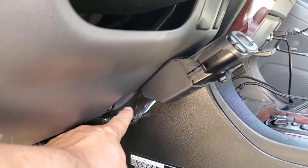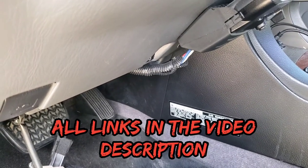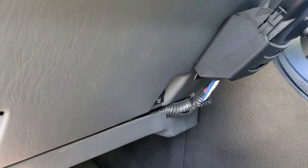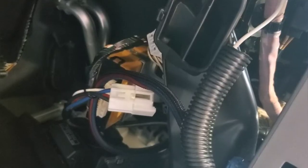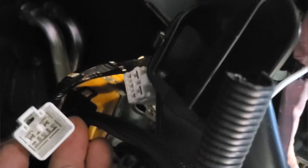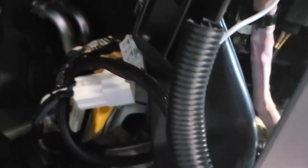What you're going to have to buy with this brake controller is a cable harness to mount up to the factory plug underneath the dash. On the lower panel, the harness assembly for the brake controller — you can just notch out this lower plastic and run that harness up inside the dash. This little panel comes off with a single 8mm bolt, and that'll let you access the area where you need to plug into the vehicle's factory harness. Way up under your dash you're going to find a little five-way plug that's electrical taped up and hidden under the steering column area. That plug is going to connect directly into your brake controller's harness assembly made for this vehicle — the GX 470 or 4Runner — and that's all you have to do to get power to the brake controller.